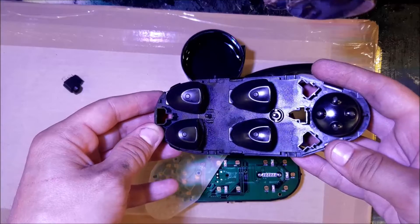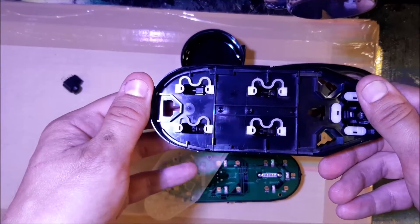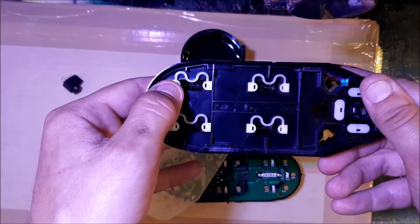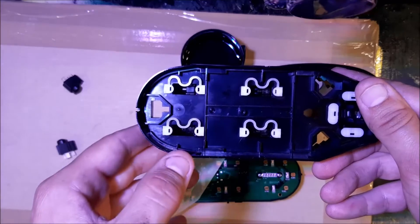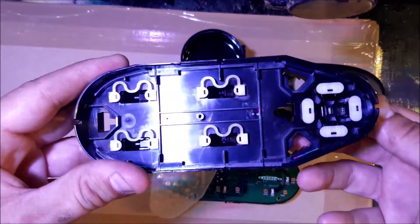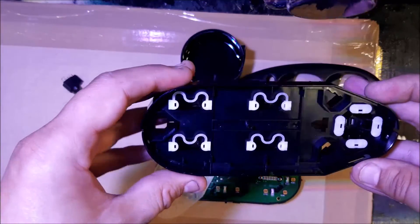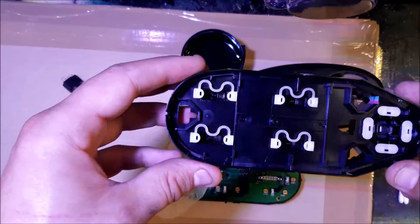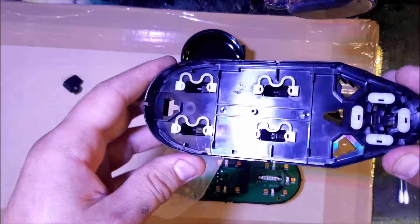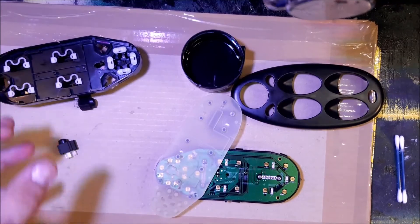We've cleaned TV remotes this way very successfully, which gives us confidence this fix will help the mirror switches and possibly the electric window switches as well. I've also gently blown all the dust out with a little bit of compressed air, just to make it easier to clean. If I turn it upside down, you can see that rocking the switches pushes that little bit of rubber down one side or the other onto the membrane and down onto the circuit board — quite clever, and the same well-used technology as in TV remotes.